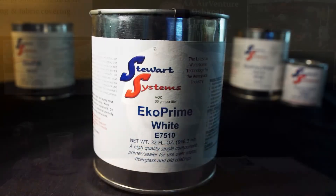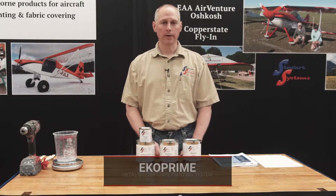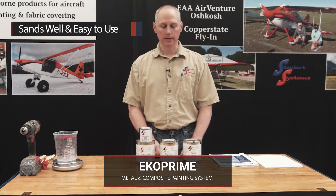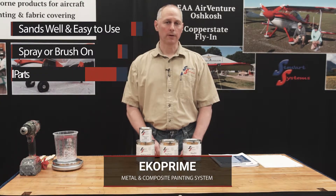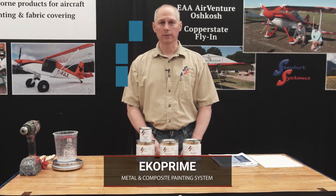We need three cross coats on a certified airplane — that is a critical aspect. The second primer we'd like to discuss is EcoPrime. EcoPrime is primarily for metal and composite. It's a single-part primer. It sands really well and it's very easy to use. You can spray it normally, you can also brush it — there are different ways to apply it. It's great for small parts and for interiors of airplanes. Some people will use it on an entire airplane, and that's acceptable as well.